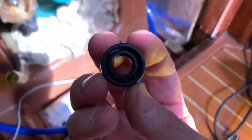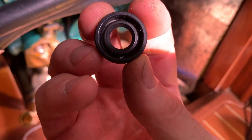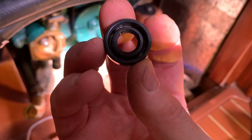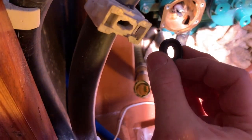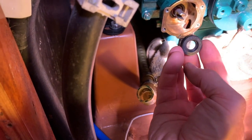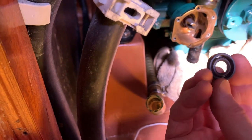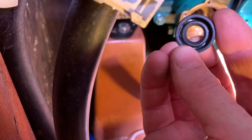It looks to me like this Volvo one has — I can't quite tell — if that's stainless steel or copper for that spring. There are high quality ones you can get that definitely do have stainless steel, and they're only a few quid, but obviously they're very expensive from Volvo. There are two seals in there: the one you can see facing outwards seals against water, and one behind it after a spacer which seals against oil from the engine coming out.